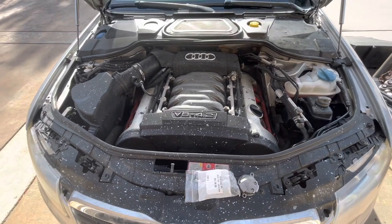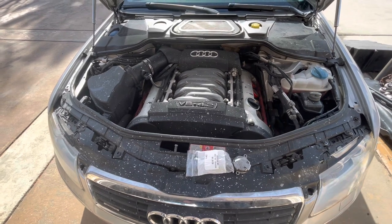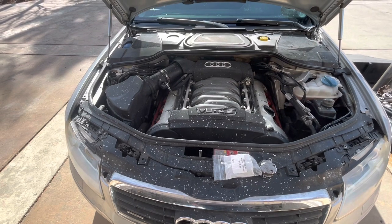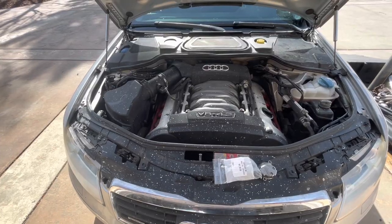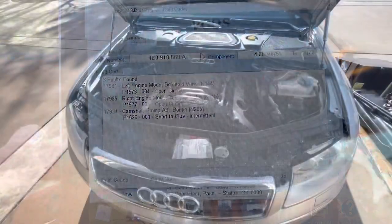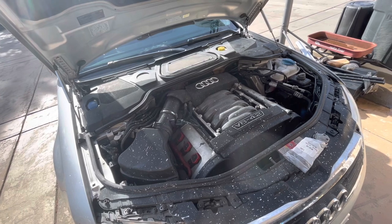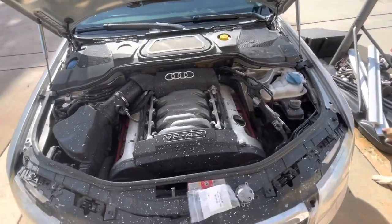That was a screenshot of the P0010 from the pocket scan. I then did a full VCDS VAGCOM scan and it came up with a P1526 code, which is camshaft position actuator solenoid shorted to battery plus or shorted to voltage. As you can see in that screenshot, there was a 17934 code, which is the Audi factory designation for that code.